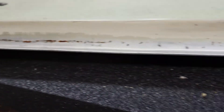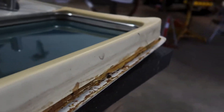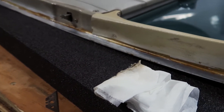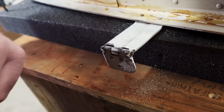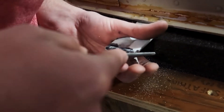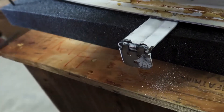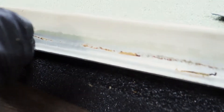Oh, look at that, Greg — my goodness, it looks so good. I ain't going to leave the bottom until it's done, then I'm going to go to this side. So we still got lots to go. Are you grinding off the... yeah, I'm going to just file the head of that pin off. I probably could have grabbed a Dremel but I can be a little more precise with the file — just grinding the head off like a rivet. Then we'll use this as a pin to make it a lot easier to take the door on and off. Greg's got his side looking good over here. We can sure see it a lot better in this hangar with the door off like this.